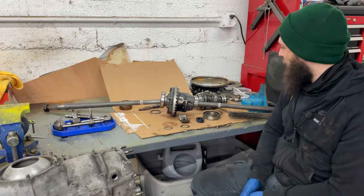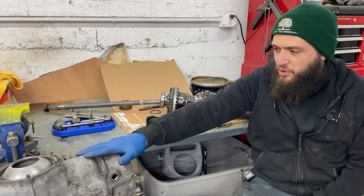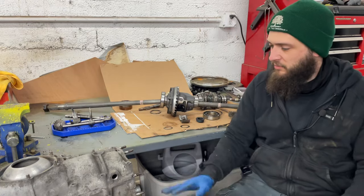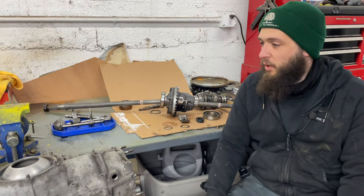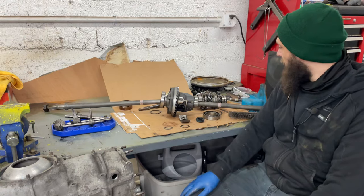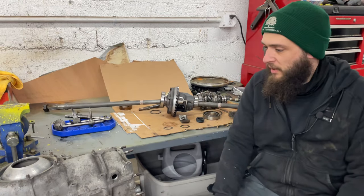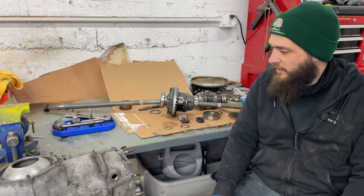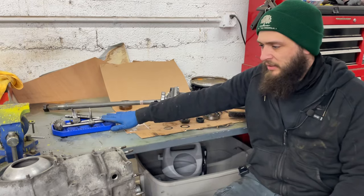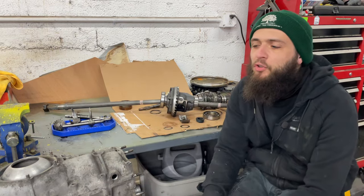I've got some cleaning to do before we can start putting things together. I did bring the case halves to a transmission shop to be hot tanked, and it got a significant portion of the crust off, but I want to go over it a little finer to make sure all the crap is off. I have a whole bunch of hardware in an ultrasonic cleaner right now. There's a couple of other things I've got to do before we can start shoving things back together. So let me get the cleaning done, and then I think the first step is going to be getting the forks and whatnot in place. And now that it's been a few weeks, I don't really remember how they go back together, so...